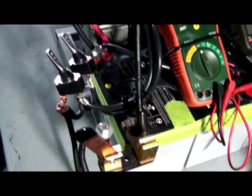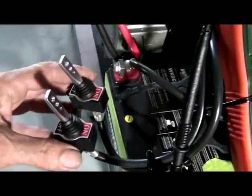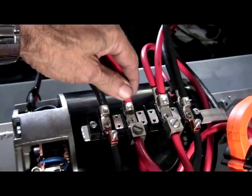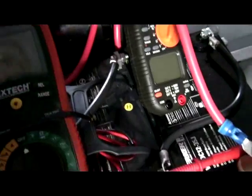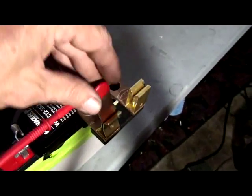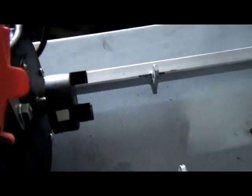Okay guys, this is the setup I'm doing. I'm just testing the motor on the bench. I have connected these safety plugs. I got two switches to turn on, and this is hooked the same as a factory — they're all in parallel. Meaning red with red on the top and black with black, and also on the bottom the same thing: black with black, red with red. I'm feeding batteries straight through this positive, so now I have it reading at the amp meter. I have also connected a safety red switch here. I have set up the motor to take the RPMs with the signal in it, so we can read RPMs.